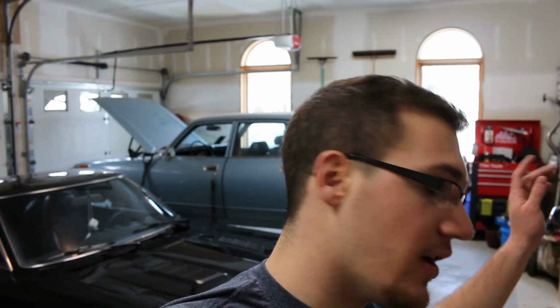Even though we unboxed these wheels and there's a video right now, it doesn't mean they're going to be on the car, like I said, for a while. But in the next Datsun video, we are going to see if we can fix the rich issue that the Datsun is having. Always running rich and not really running 100%. I have a feeling it has something to do with the mass airflow sensor, or meter. So we have another mass airflow meter, and we are going to swap that out and see if we can make the Datsun run a little bit better.